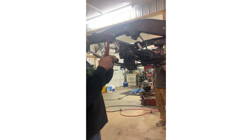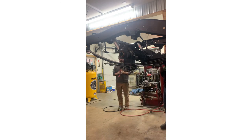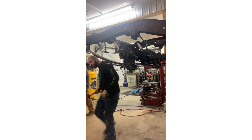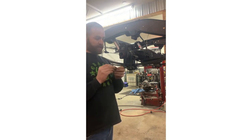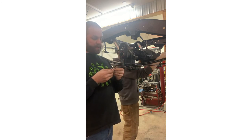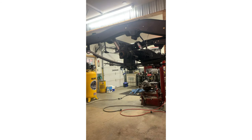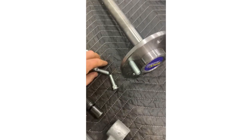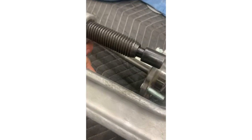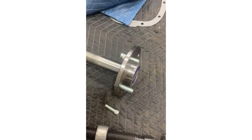We got the bearings and seals installed. Funny thing to mention about the C-clips: I couldn't find them - they fell off my bench rack and I found them on the floor in the dirt underneath it. That almost got pretty scary. Now we're down to our new 28 spline Richmond axles. We're pressing the studs in using a ball joint press - just set it on there and suck it through with an impact gun, so we're not hammering on the flange.